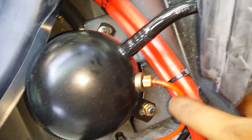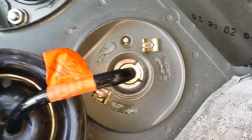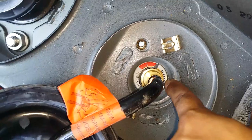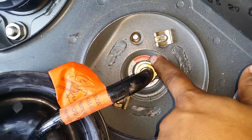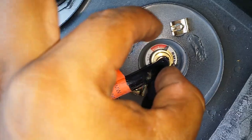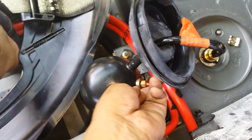Once the air is completely off and you don't hear any more air being released, come here and pull these pins out. Notice there's a clip right there and another one — you need to compress those together and slide out. Once you do that, the hose comes out. For now I'm just gonna let the air escape completely.